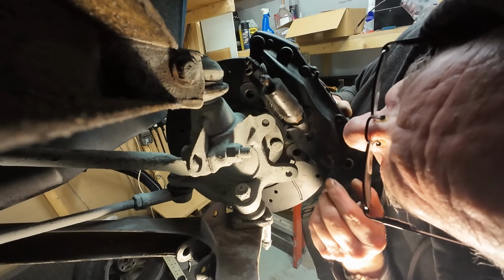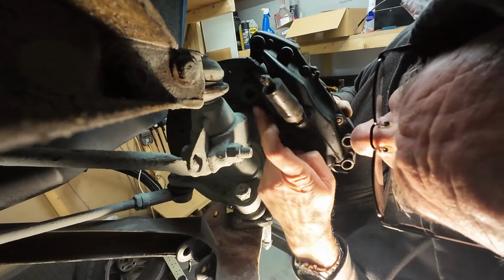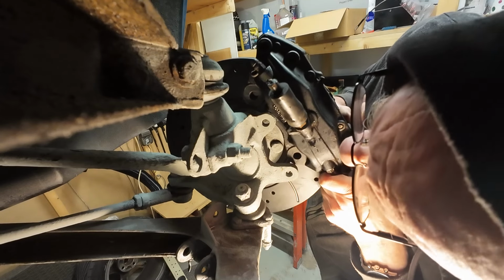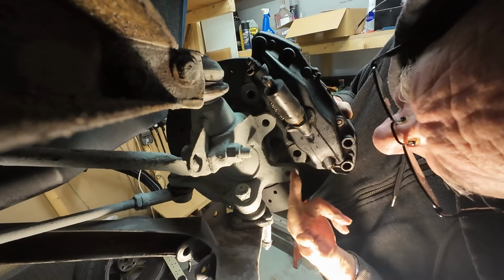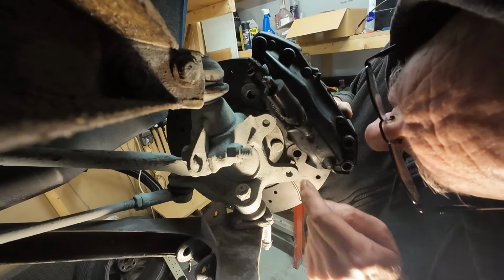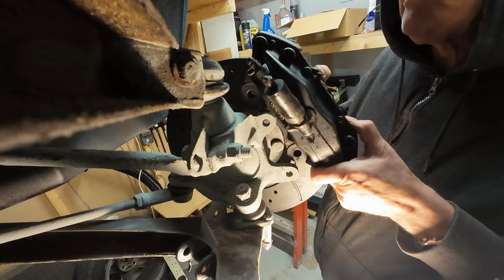And I've got to pick up that lug up there. So the steel will taper off up there, and it'll be milled away again. So it'll come all the way down here, bolted through from behind. And then, I mean, it's going to be a right job putting them together. But that's the plan, and I think it'll work. Obviously, that hole isn't in line with that hole, hence the reason I've ordered a piece 50mm wide, so that I can pick up this fully with a full bolt hole, and pick up this fully. I measured 40-odd millimetres. Okay, so I'll turn that back off.